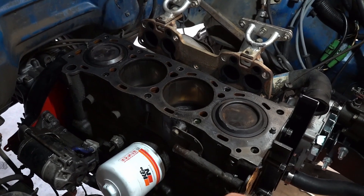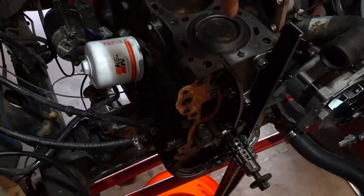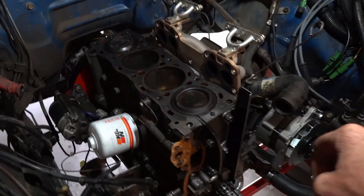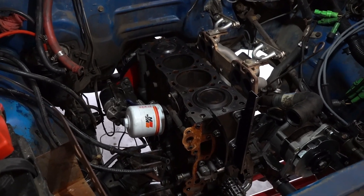I looked at the head and the valves are fine — they made no contact, they're not bent, and they're all sealed up. So it must have been sometime in the past that someone set the timing wrong or a timing chain broke. It got replaced, and maybe that's why the cam gear was on backwards — someone changed the head or the valves or something. Anyway, now it's waiting for parts — need a new gasket and then put it all back together.